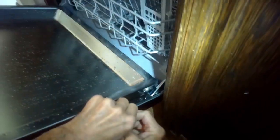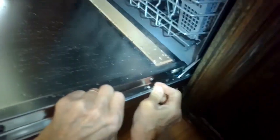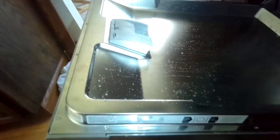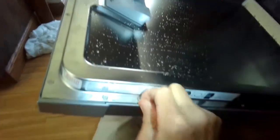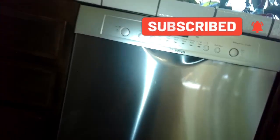This part you can just kind of pick out — take your time. If there's some remnant that really bothers you, you can loosen these Torx 10 screws a little bit and then you can get to the film, because it's kind of caught between the two panels. Now it's a lot shinier — looks great.